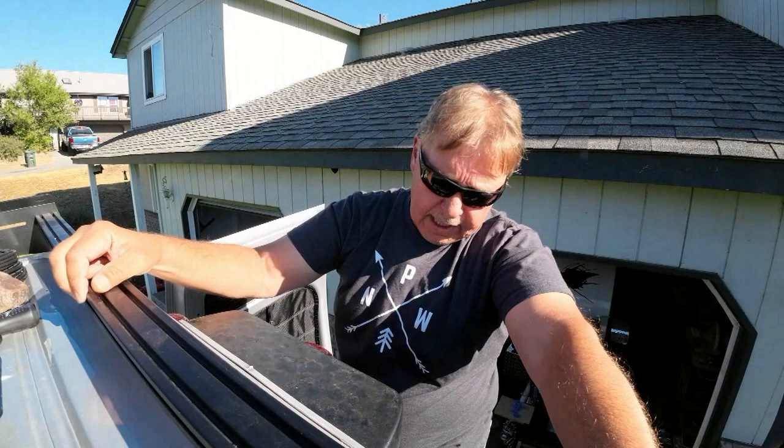I'm going to take this down because I want to drill a couple of clean holes. With the rear light housing off, I basically took our gland setup and eyeballed the center for my holes, about the same distance apart as the gland — two marks right here. We're going to drill two holes, about three-quarter inch, big enough for our bulkhead fittings to slip through. I'm going to use a step bit.